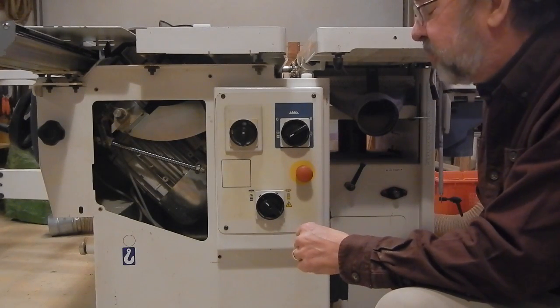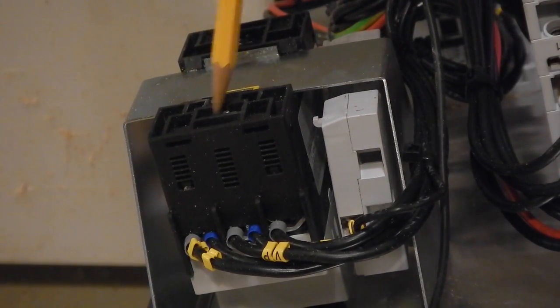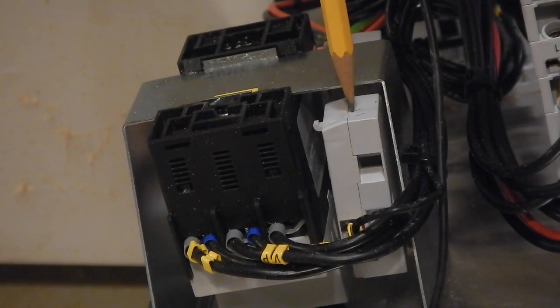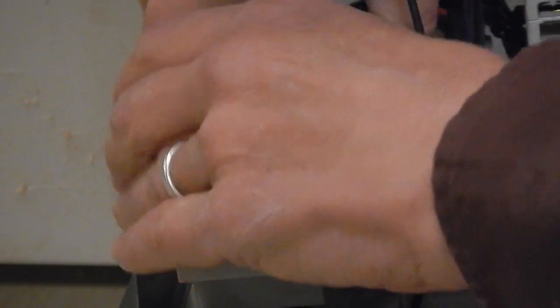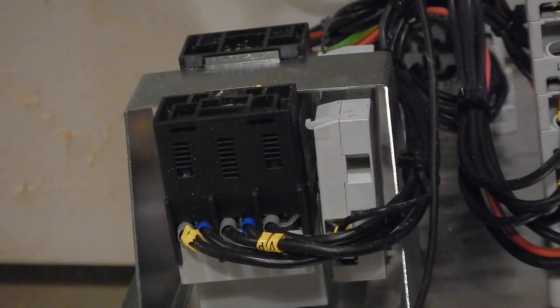So the next thing I did was take this panel off and see what I could find. I noticed that this component here had become separated from this component — this is the main rotating on-off switch. About a year ago I replaced it because it started to buzz, which I thought meant it was going to fail imminently. I ordered a new one and installed it, but obviously didn't get it installed quite correctly. There are little tabs — it should be snapped into the main piece. When I seated it properly, everything started working correctly again. This is obviously the linchpin of the whole safety circuit.